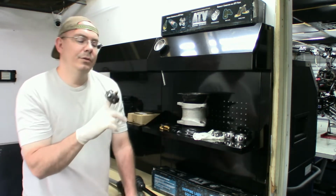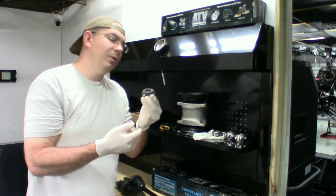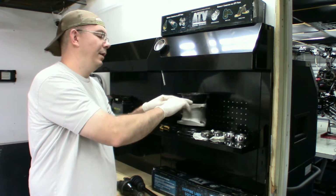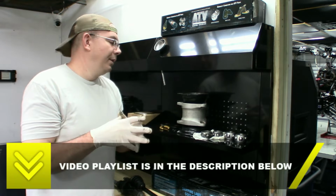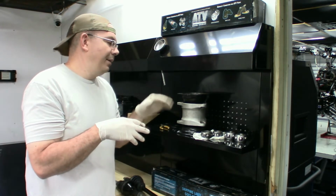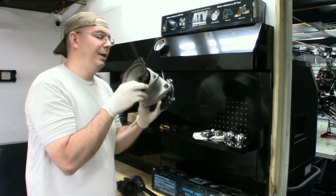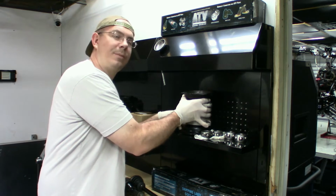So a lot of the rear end problems, I would say, are these internal bearings. Once the grease starts to lose its greasiness, it scores the internal of the carrier here. And one of the other things is the internal bearings as well, which I have a great video on disassembling this rear end, check the playlist. That playlist will really help you out if you're going to do some of this. The internal of this carrier can get worn in the lines, and once it starts wearing down and there's no grease doing its job in there, you really have no option but replacing it.